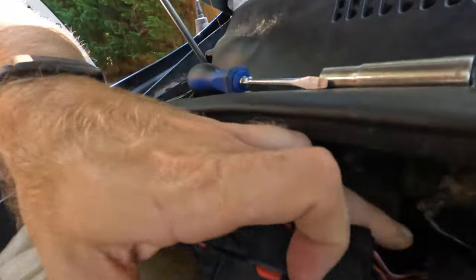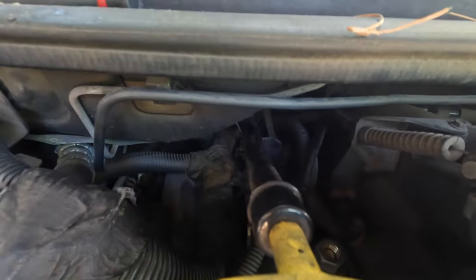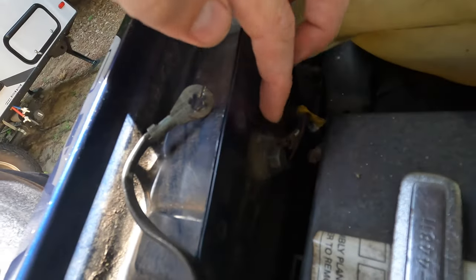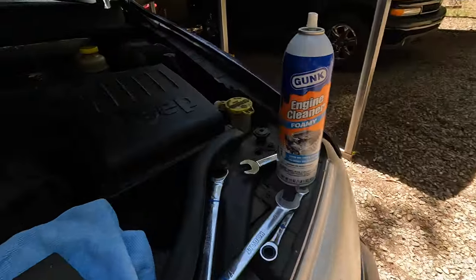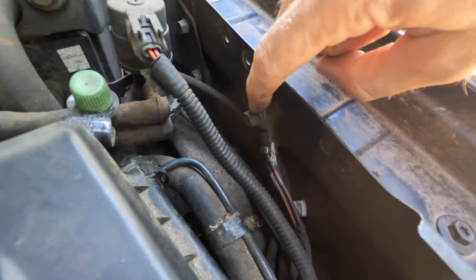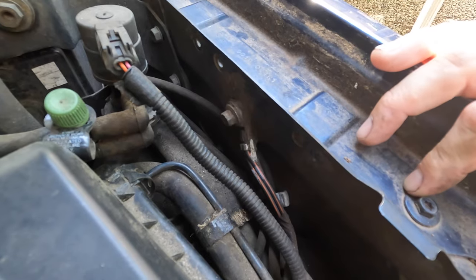I got one ground cable off — it's pretty well soaked in oil, so I'm just going to replace this one. There's another one that goes back and mounts to the injector; it looks intact and that's tight back there so I'm going to skip that one. But you can see this one here is just covered in grease and dirt, this one the same thing, and over on the driver's side this one the same. So I'm going to bust all those loose, clean them up, and put them back together, then replace the oily one.